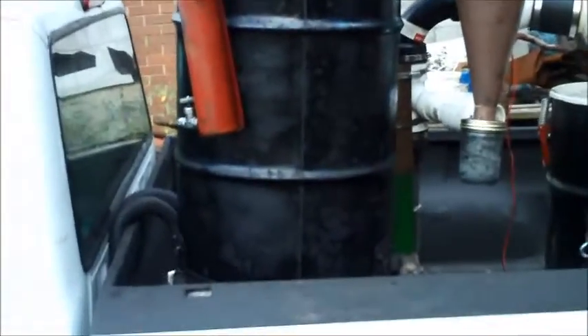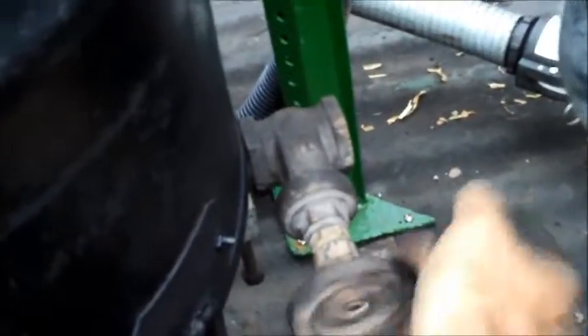So there's the system — I'm very pleased with it. The gasifier weighs about 50 pounds, the air filter weighs maybe 10. I had this running yesterday so it's still a little warm and the fire is still burning in there — I don't even have to relight it. I can just open this valve, fire up the engine on gasoline, head down the road, and this will start picking up the fire. Probably about two to three miles and I'll be able to switch over to charcoal gas. Charcoal gasification — very simple and I'm really pleased with the results.